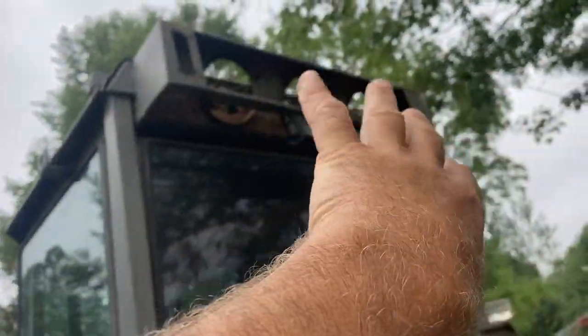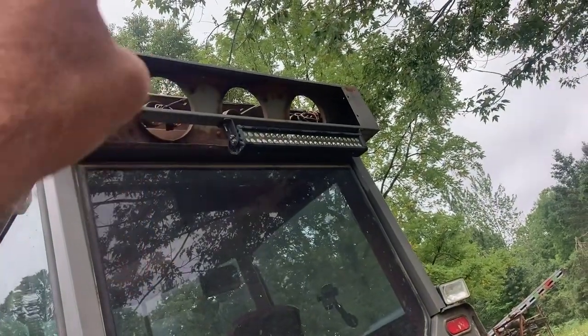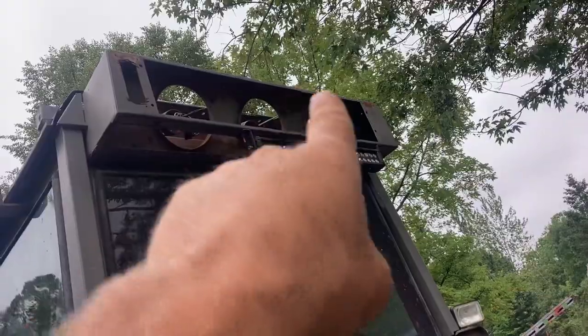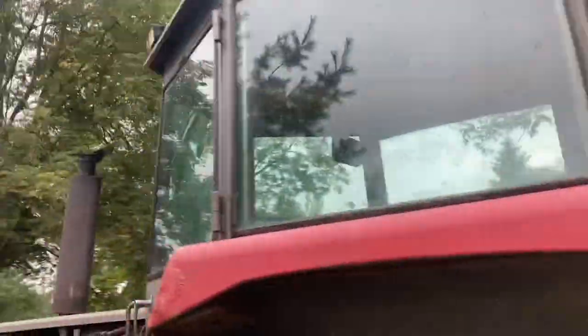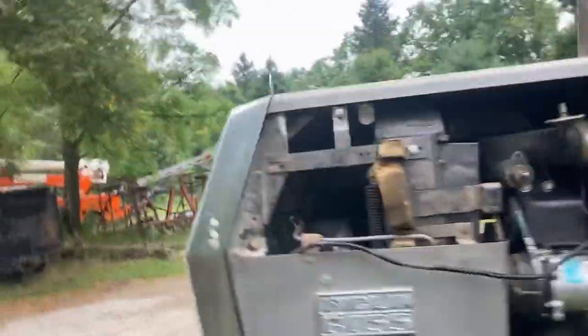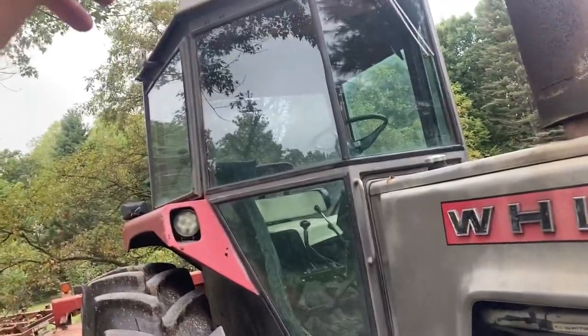The original setup had three little electric motors with fans blowing through the condenser, and that's a really bad environment for them. Those fans would short out all the time and short your whole electrical system out. Part of this was they had a pretty small alternator — these things only came with a 63-amp alternator, which was stupid. Plus, exposure to the weather didn't help at all either.